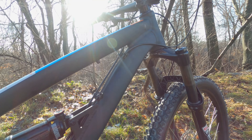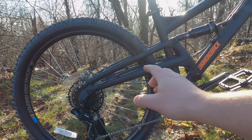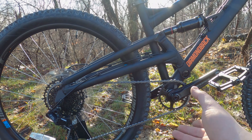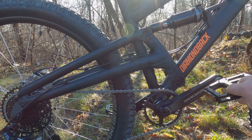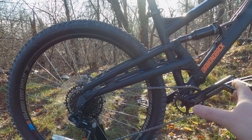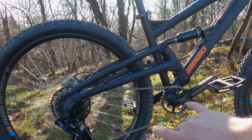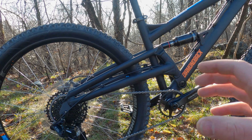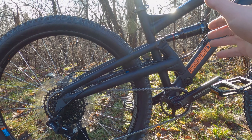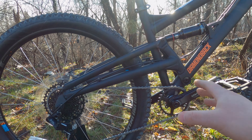With that pivot up and in front of the bottom bracket, it's going to have good anti-squat properties — meaning when you pedal, it's going to try to elongate the suspension, so it should pedal pretty well. The downside is you're going to have additional pedal feedback because the chain and the rear wheel are integral into how the suspension is working. It also has a bit of anti-rise where, when you use the brake, this high pivot single pivot suspension will sort of lock out the rear end when descending. It's a trade-off, but it keeps the design inexpensive because this style is easy to manufacture.